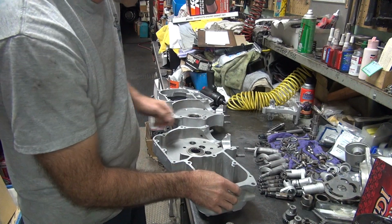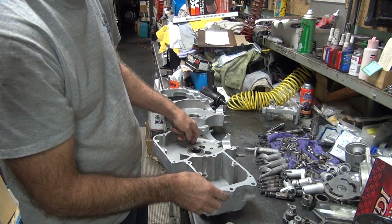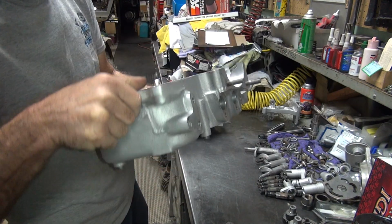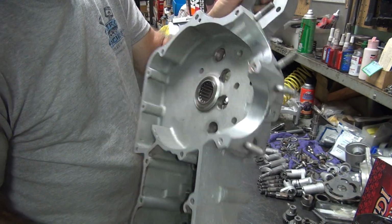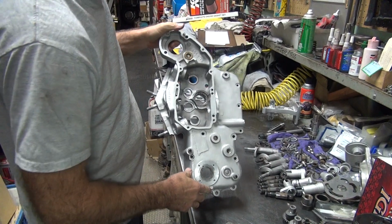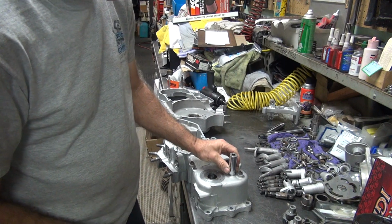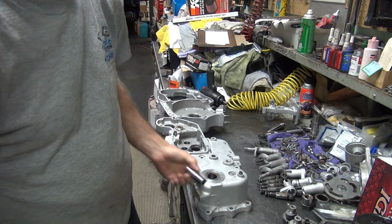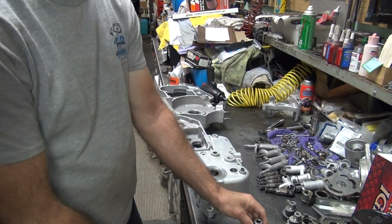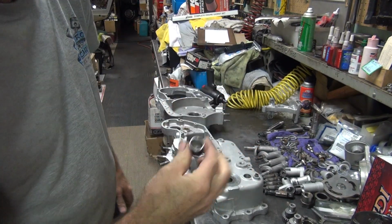Yeah, the lip's pretty well gone on the inside of the case. So, there's nothing to keep the bearing from going too far this way now. Either machined or pressed in or something. So we'll be putting sleeve retainer Loctite on those to make sure they don't go out too far that way. This one doesn't matter which way you go, as long as it comes out. So that's getting to be replaced.